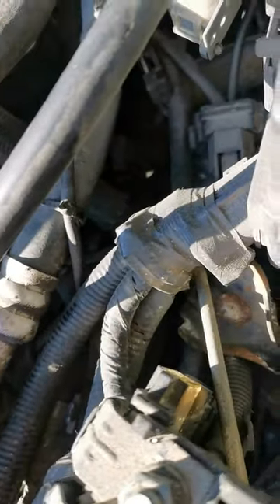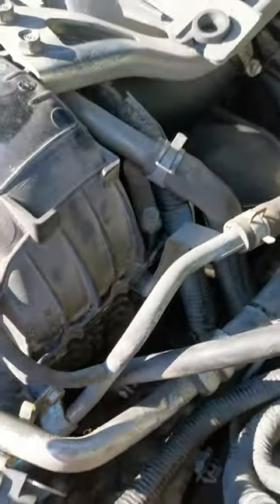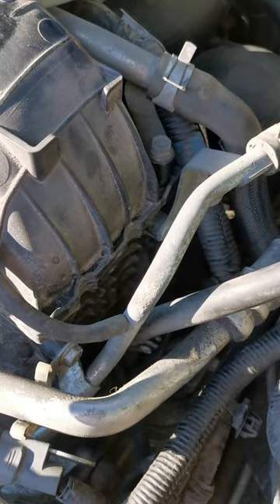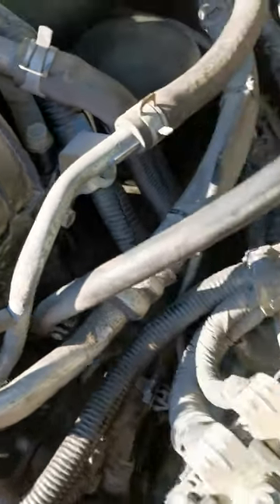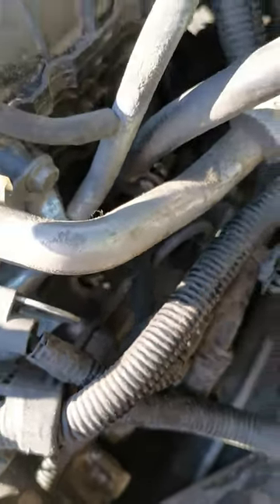Touch the red one to the top and it should read maximum one — that means your glow plug should still be okay. You should hope it is, because it's not that easy to get them out.